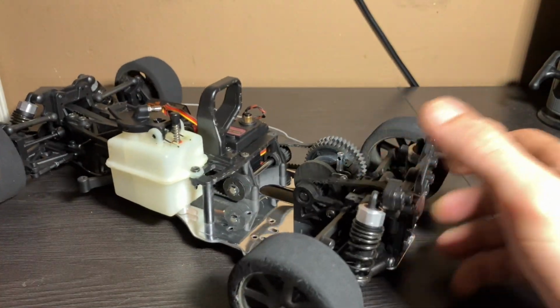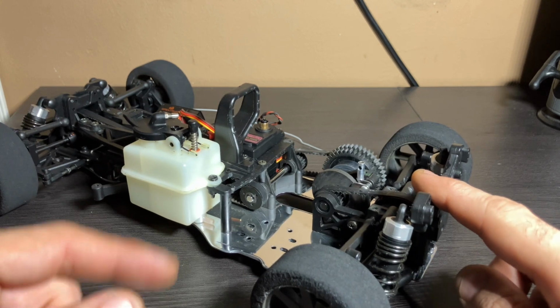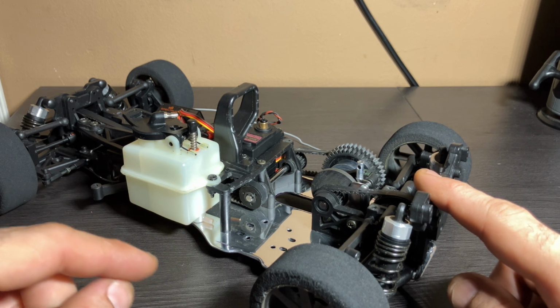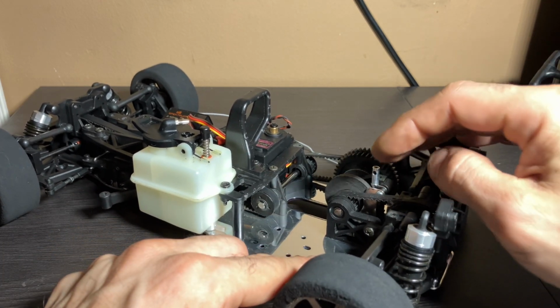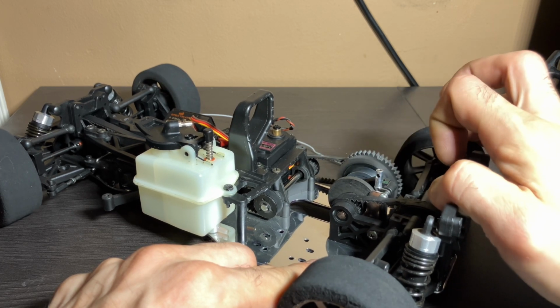But this system is different than the single speed. The single speed is locked to the shaft, so as you move it forward in reverse, these are spinning. But as you can see, depending on how fast you spin your vehicle, those will spin at different rates, and one might stop and not spin at all. So you want to also make sure that this inner one is spinning freely, because that's your second gear. So you don't ever want that one to lock up.